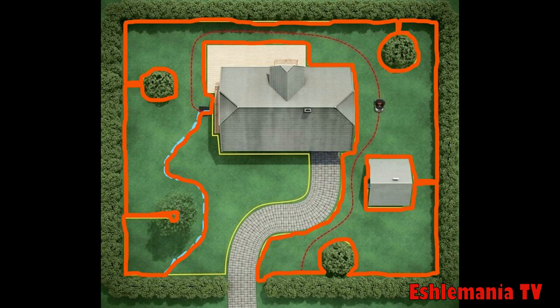This is how you narrow down your area so you don't have to walk the entire property. One important reminder before you start doing any of this: make sure you have your wires labeled. I've seen guys do this with wires crisscrossed and switched around, which caused more headaches. If you have your wires labeled correctly, just hook them back up to where they belong in the charging station and you'll be good to go.